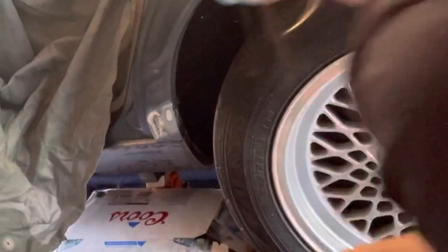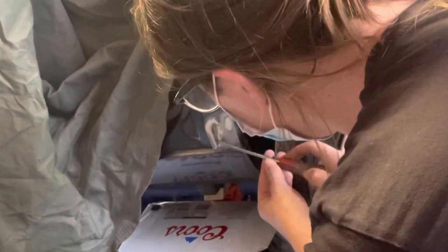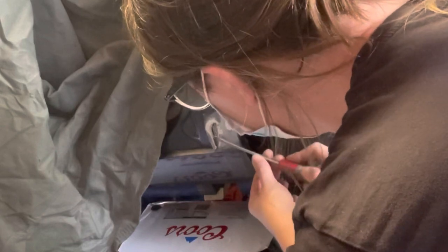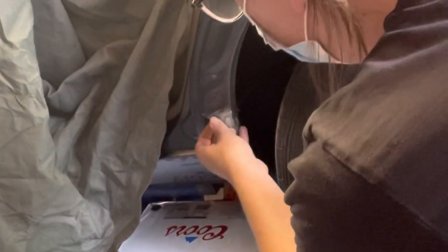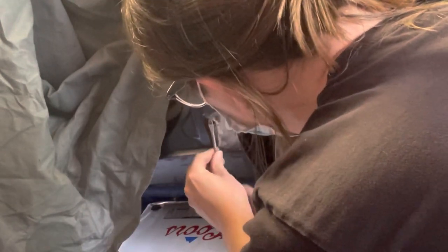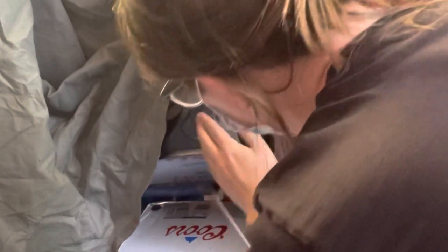Some of the most useful tools I've got is this bit of old foam — everyone needs a bit of old foam in the garage. I'm going to pick the loose stuff off with a screwdriver. This feels quite violent, but remember it's just filler. That's mostly bad metal underneath, so that's fine. I'm ready to stop with the screwdriver — it's starting to get solid-ish here, so I might switch back to the sandpaper.